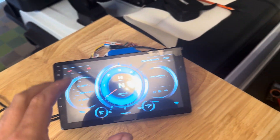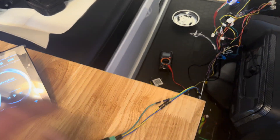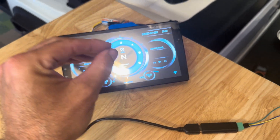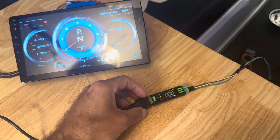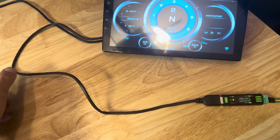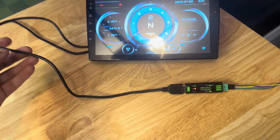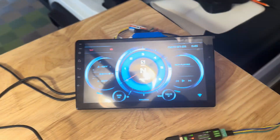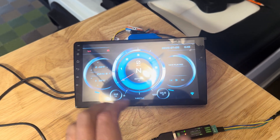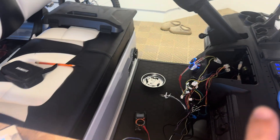So far what I've learned is that I've been able to tap into the CAN settings and read what's available using my PC and just normal CAN bus software. To get that data fed into RealDash, what you're going to need is a USB-to-CAN WaveShare adapter. All I've done on this Android device is plug this into the back of the device using their existing USB slots. This is just an Amazon special — $145, four gigs of RAM, 64-gig hard drive. The display unit fits as a direct replacement in size into the Evolution Cart.